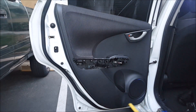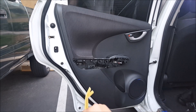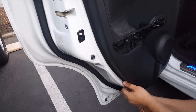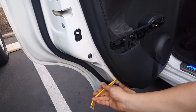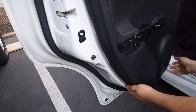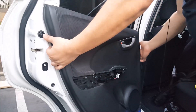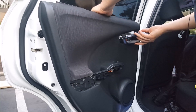There are going to be clips holding this in place. Work from the bottom up and pry it in and pry it out — I'm going to work from the bottom. Pull it out from the bottom. Once you have the clips removed, grab it from the side, pull up, and unhook them apart. Then just twist this door handle so that it goes inside.